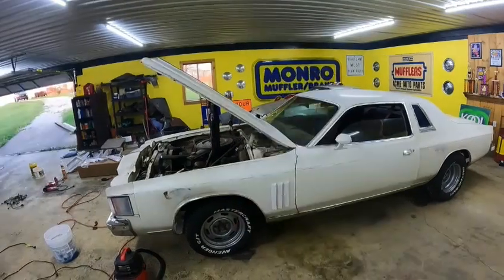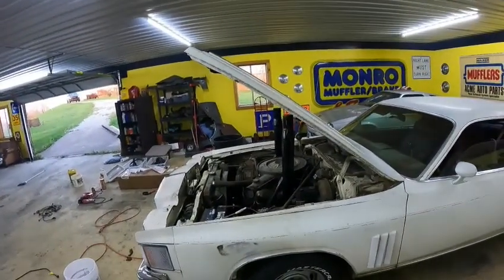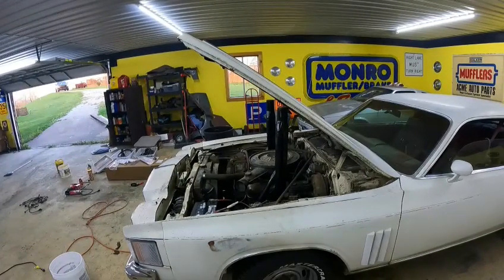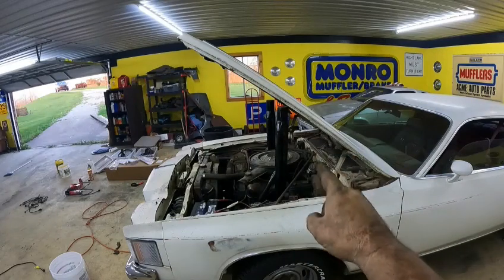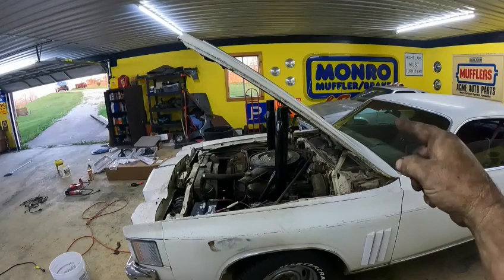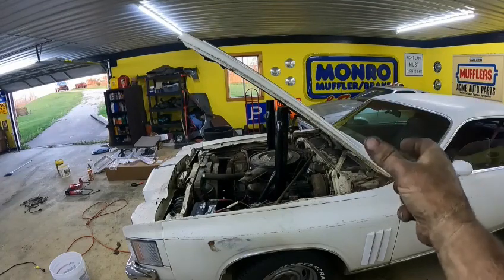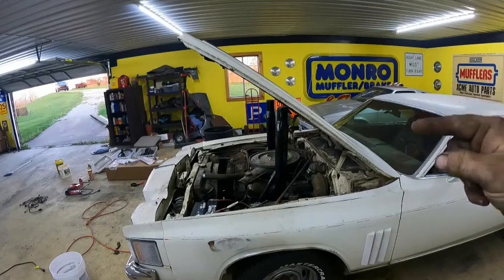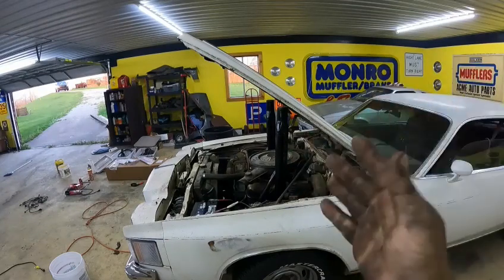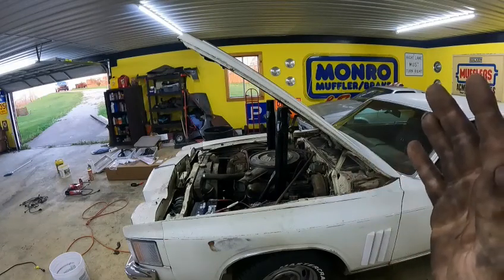Hang tight a second. All right, guys, I'm gonna go ahead and butcher this nice, perfectly straight hood. So the plan is, I'm just gonna drill pilot holes essentially where those stacks come up and meet the hood, and then I'll get on the backside, center off 6-inch by 6-inch squares off the center of that hole, take a cutting wheel and lay the hood down. Now, again, this is not gonna be the prettiest thing in the world. This is a burnout car, so bear with me.